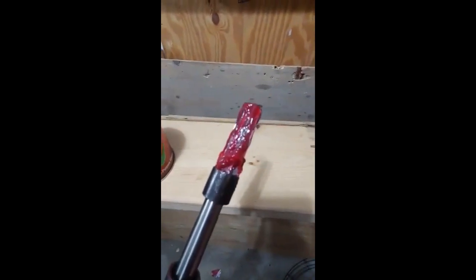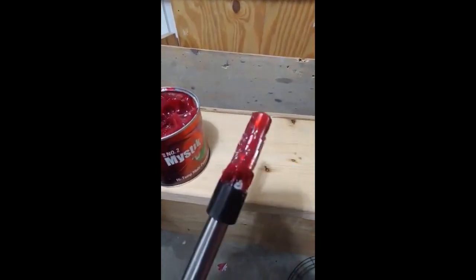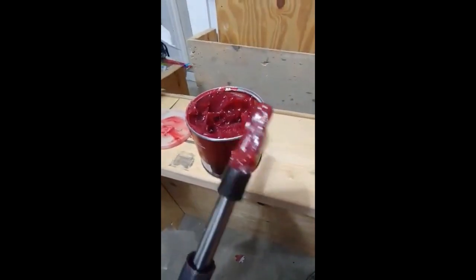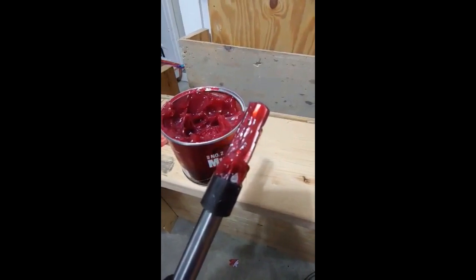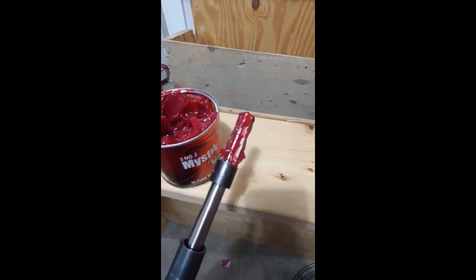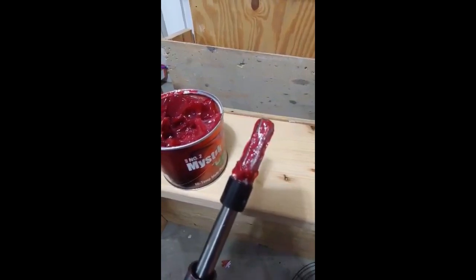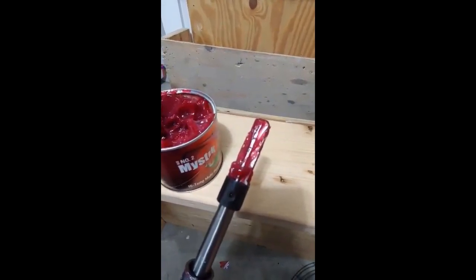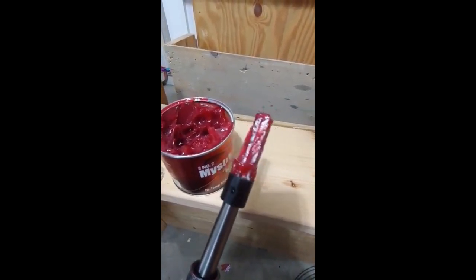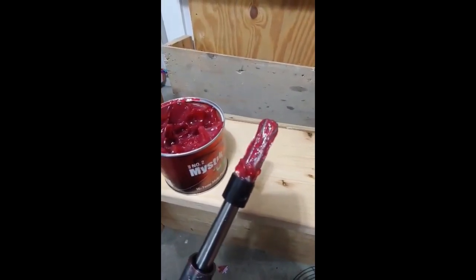One thing that the kit suggests is, on the reaming tool, to pack the flutes with some heavy grease. I just got some store brand grease, and so as you are making the chips from cutting it, they get collected in the grease and don't fall down in the cylinder as much anyhow. So actually pretty good idea. So far so good. We're about 2/3 of the way done with the ream process, and then we'll cut a few threads and we'll put our insert in.